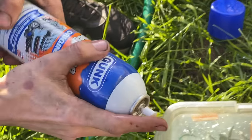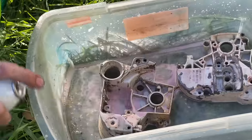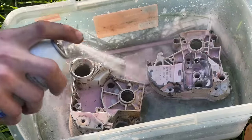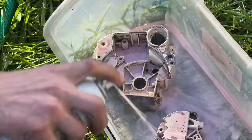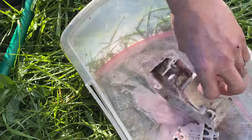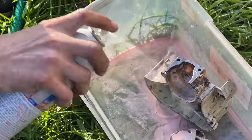This Gunk cleaner is really good stuff. When you powder coat, you want to try to get all of the oil out — even oil that gets inside the metal. You have to get that all out, otherwise you'll see it when you powder coat — it'll show up through the paint basically.